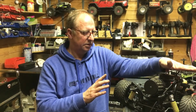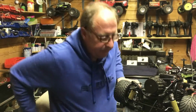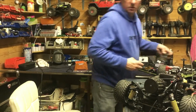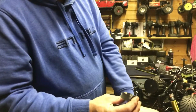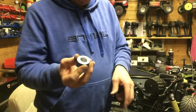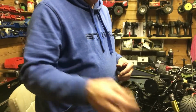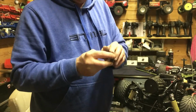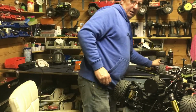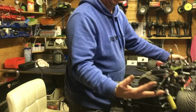The camber was set fully compressed to 3 degrees or something like that. All of this was done on a budget, so I taped up a few washers to set the height, I think that one's like 18mm, 16mm and 9mm and 10mm to set the different heights and to set the droop, and stuff like that. So hopefully it's set up. It starts third pull and we're ready to rock and roll, so really looking forward to it.